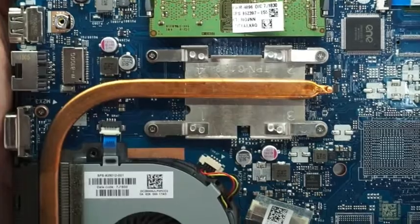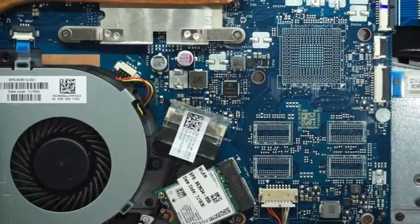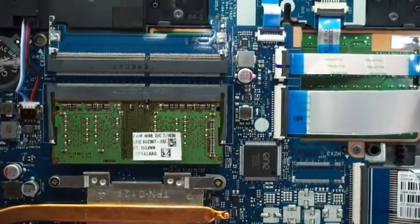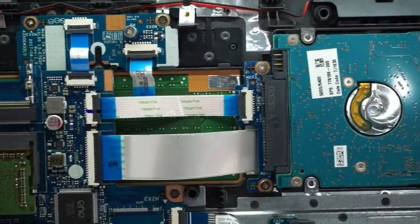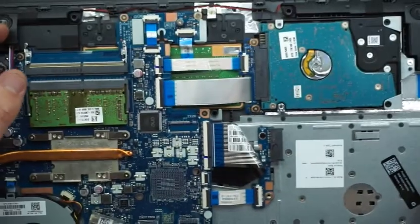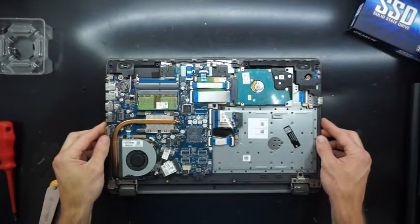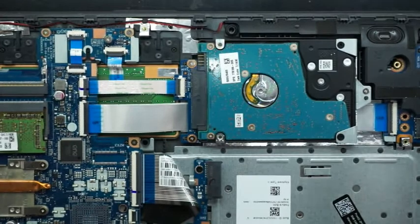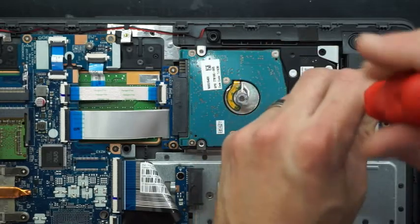We have an extremely simple copper cooler for the i3-6006U processor. We have a removable DC jack. Going up to the top and across, we see the connections for the hard drive. The hard drive in this one is quite poor — it's something I definitely don't recommend using at all these days. From here there's really not much holding that hard drive in place. You have the connector itself, and you have one metal bracket which features three screws, one of which is only going to the mainboard.